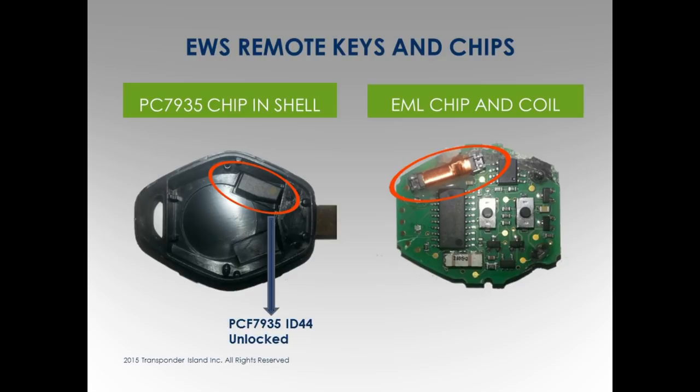So what I'm gonna do is, so that the transponder on this board, the OEM, can no longer function, I'm gonna take this coil off. This is the actual transponder chip that's on here, not this. That's just the coil that's for the power. Make sense? So I'm gonna take the power source away from that chip, because I want to use my now aftermarket chip. What are they, $4? $5? Yeah, $4. So I'm gonna snap that off.